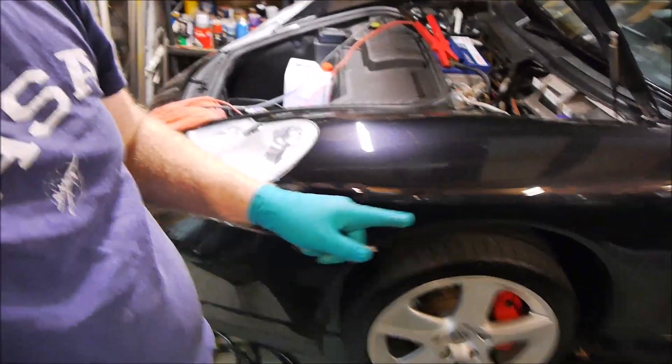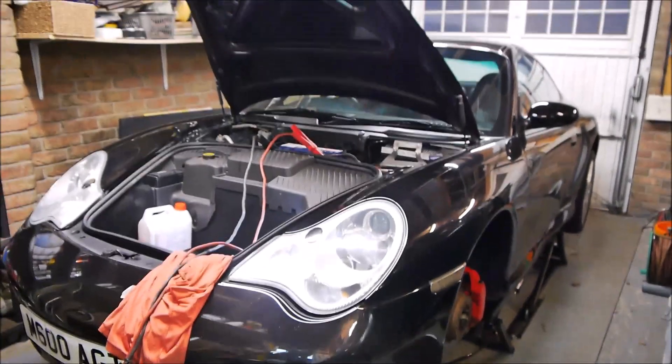Wheel off - let's see what we can do about that strut. See if I can knock it out in position. If not, I may leave the strut in, take the top mount out, leave the spring in, use the car weight to compress the spring slowly, let it off, take the top mount out, get it in the vice, and put a new stud in. Then I've got to put the belly plates back on and I think we're done.